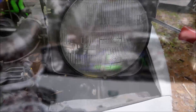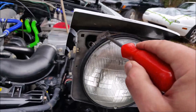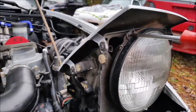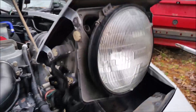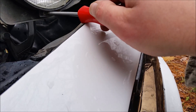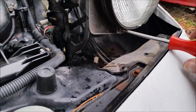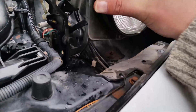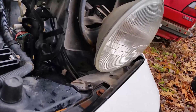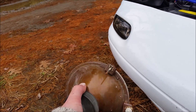I'm going to start tearing this one out — loosen up these three screws, twist the trim ring, pop that off, and the bulb just falls right out. Unplug it. Next I'm going to have to cut the adjustment tabs off of this headlight so that it will fit in there.